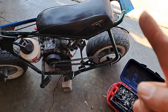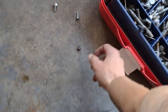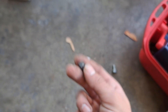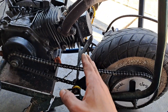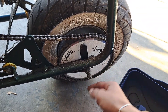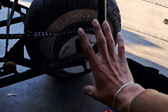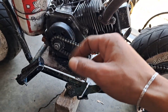I don't have loctite right now — I normally use the blue loctite. Some of these little nuts have a loctite-type coating in there already that helps them stay. Everything that needs to be snug, loctite it. Everything that needs to be greased — like the inside of the wheel, the axle — I grease all of that. And my chain was pretty nasty from the ride.